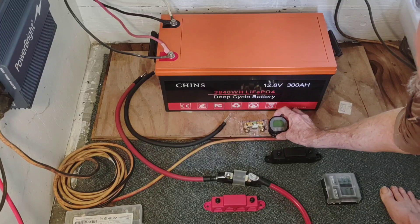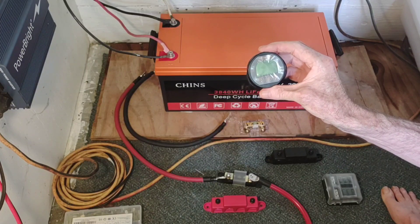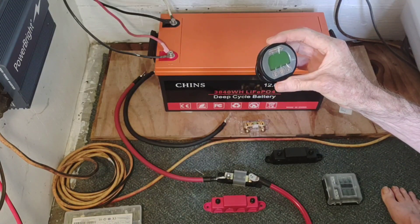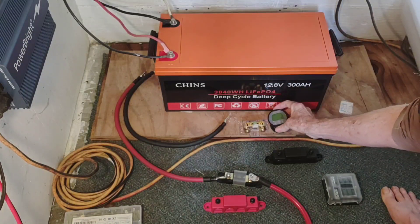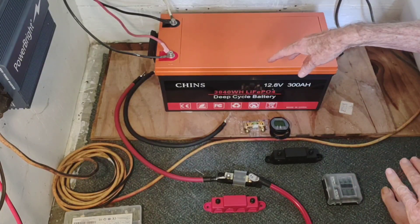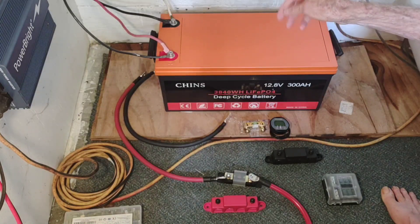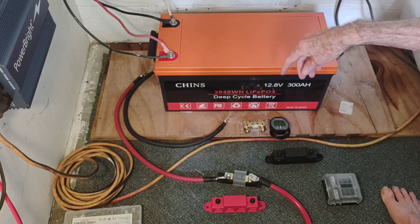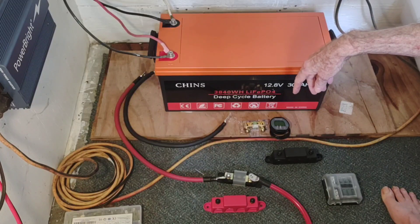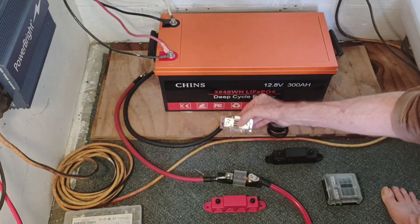Here's that Ali Express — or Q-Work, depending, as it's advertised under both names — battery indicator and battery monitor, which will give you a gas gauge reading of exactly where your batteries are sitting. That's going to be most helpful to just at a glance be able to see the state of charge, because as those of you running this chemistry know, the voltage on your charge controller doesn't change a whole lot during charge or discharge. So if you really want to see the state of your battery bank, put in a battery monitor. This monitor came with a shunt.